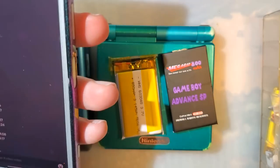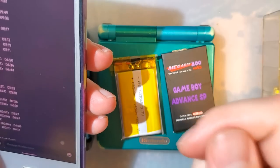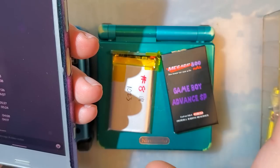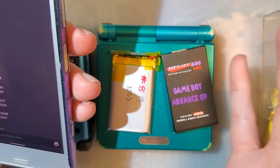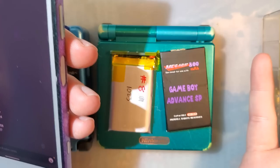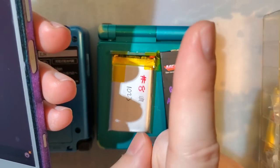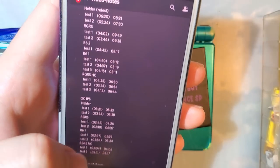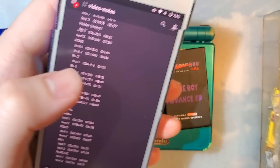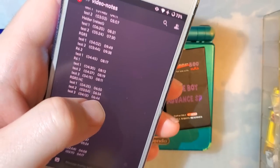It wouldn't charge. Eventually, I took the battery apart and hooked my battery charger up to the bare terminals on the cell, bypassing the protection board, and I got it to charge fine. It still seems to work fine, but the protection board is still in shutdown mode. I don't know why. So I bought two batteries and only got one charge out of them. I only tested that battery literally once. The capacity test went just fine, but as soon as I discharged it in an SP, nope, it was done.